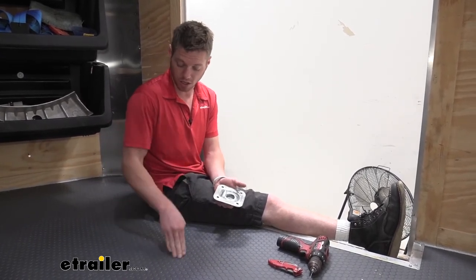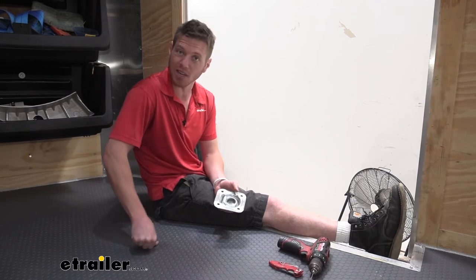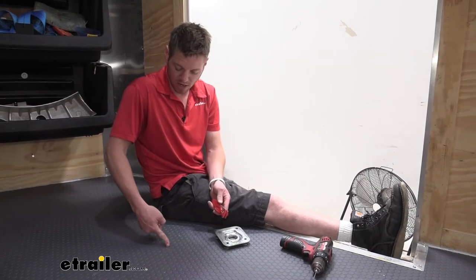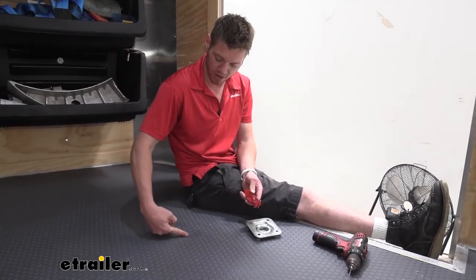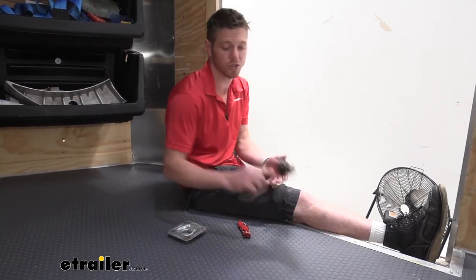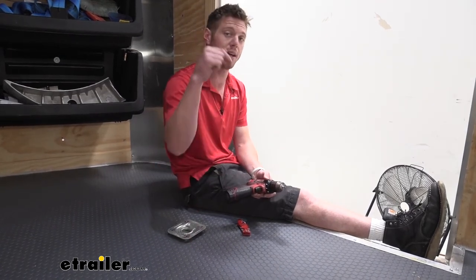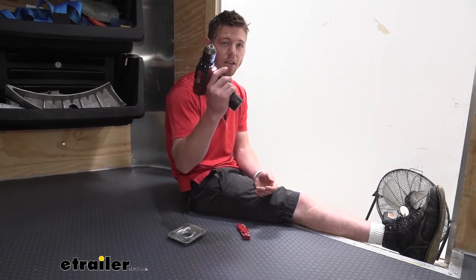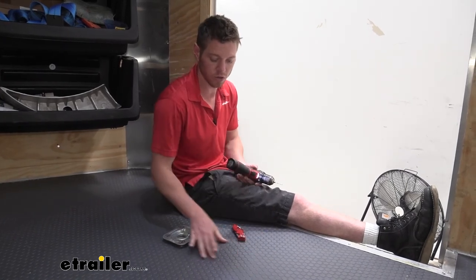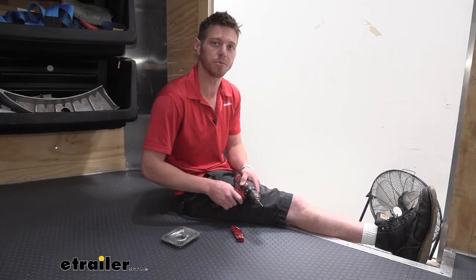Now we just need to put our accessories back in the trailer. For d-rings — a lot of them come with trailers from the factory — you can feel around or look at pictures you took before to locate the holes. Take an exacto knife, make a cross, take each flap, and start cutting it around so these things go right into place. For the holes, whether it's t-track or a d-ring, I suggest going underneath your trailer, taking a little drill bit to make pilot holes so you can see where they're at, then do the rest up top, put your backing plates at the bottom, and tighten everything up.